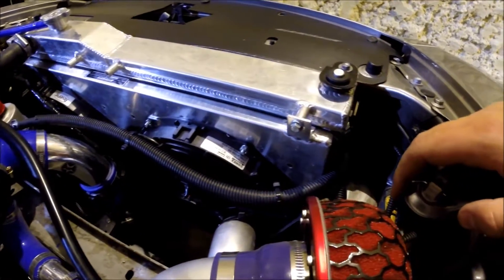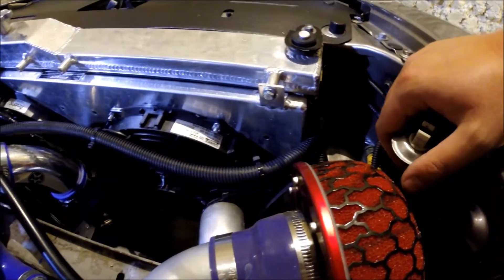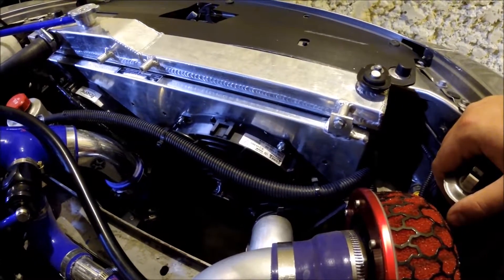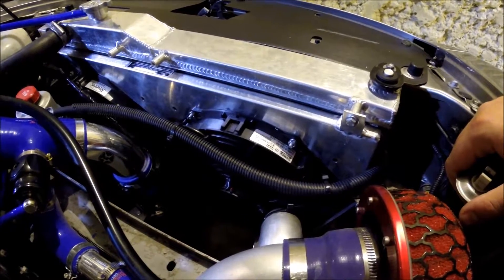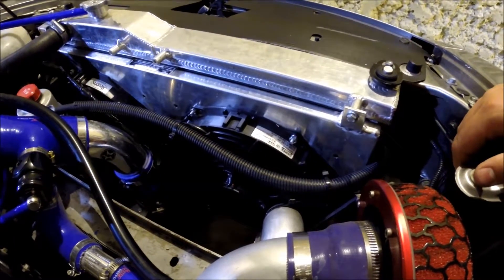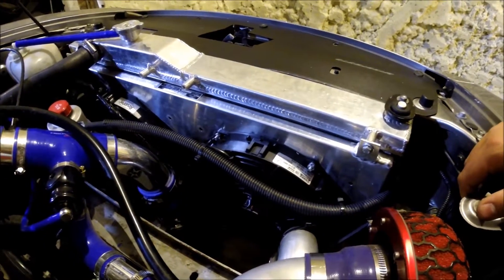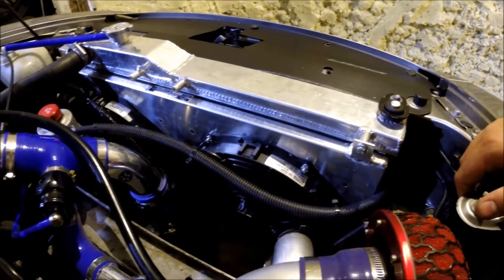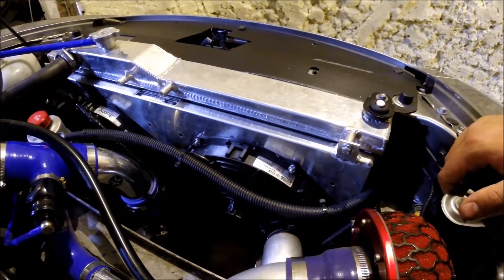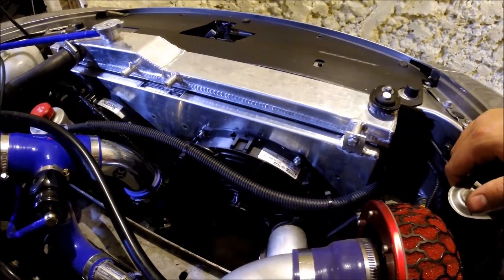You could block the leftover bolt holes from the Mishimoto if you wanted, but the airflow they let through is minimal. Driving on the road it seems quite cool — the shroud is directing air through the fan vents while driving, whereas before a lot was going past. It's been quite successful, I'm pretty chuffed. I'm now confident the car will be ready for a track day without any overheating issues. I'll have to book a track day next year. Thanks for watching — make sure you subscribe and like to see more.